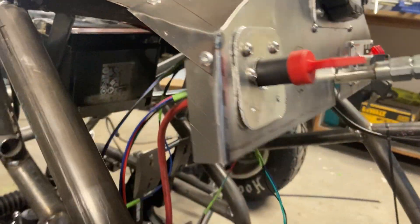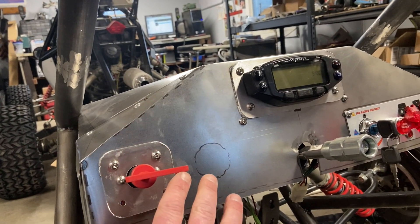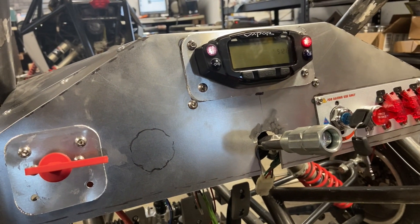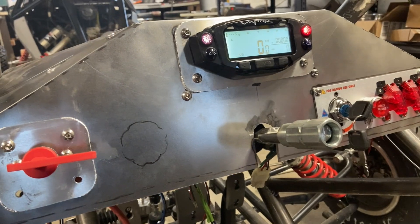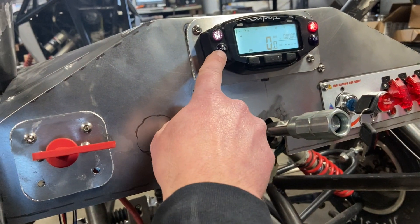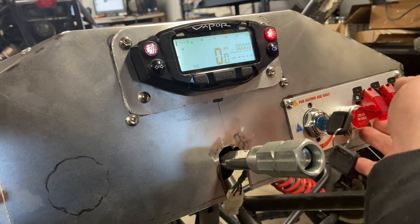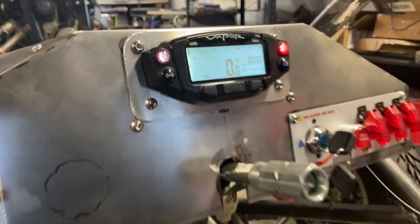All of the remaining wiring is just going to get wrapped and tucked behind the dash — it's nice because you don't need wires that are the exact length, it can still be tidy. Here's how the dash turned out: we've got our master switch that just connects the battery without turning anything on, and then the key. Here's our nice pretty dash. We've got our neutral light, our oil warning light. I haven't hooked up the lights yet and just left the turn signal relay hooked up and everything still works. Neutral on, neutral off — pretty cool.